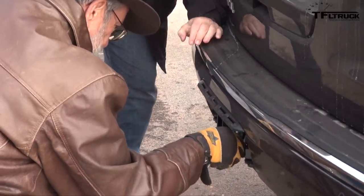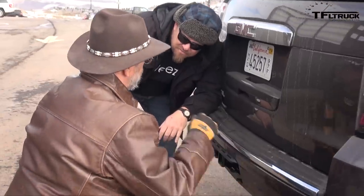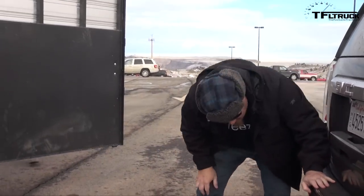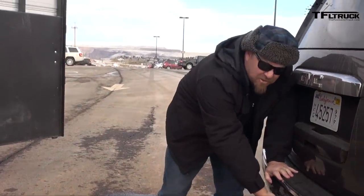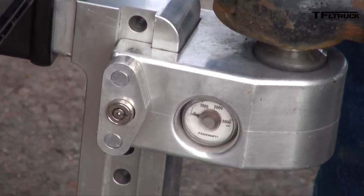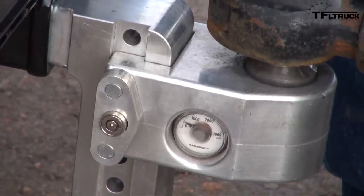So what we're doing is we're going to be dragging that water — about 2,300 pounds — so we get better balance in the trailer, better weight distribution. I'm going to hook it up to the GMC and drag it forward, but we're going to need a hitch because the chain isn't quite fitting here. Using the built-in scale in our hitch, we knew that we had way too much tongue weight. The water in the trailer was just too far forward, so we had to MacGyver a way to get it farther back over the axles on the trailer.